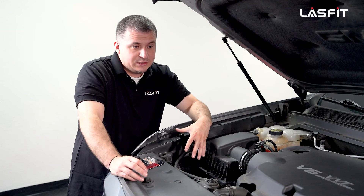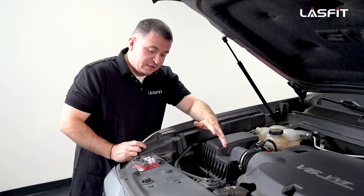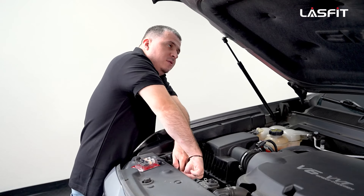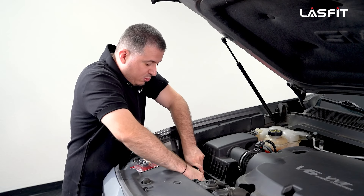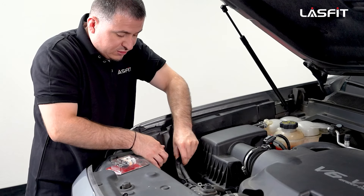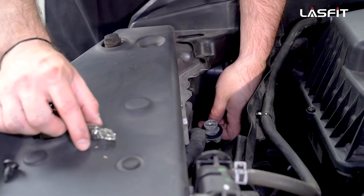We're going to do the hard side, which is the one we get most calls on. People sometimes can't get to the bulb or find it a little bit hard because there is some plastic trim here. It's very simple — just grip anything you can and pull. There's going to be a pin here which will come off the moment you pull. Grab that pin, set it aside, and then pull this plastic trim all the way back. You can also remove some clips if you want to, but for this one it's very simple — just pull this back with one hand and go in. Take the bulb out.